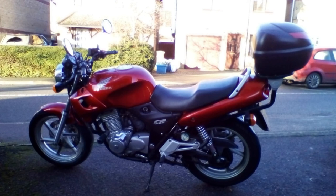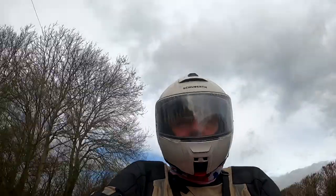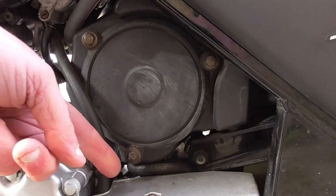There are a few things that can go slightly wrong if you're looking at buying one of these. Try taking this bottom bolt out — or see if you can — because they are prone to seizing up. The air filter lives behind this. If it does seize up, the solution is to grind the head off the bolt; the other two should still be fine. If you can't get any of them out, unless you're really desperate and fancy buying a second housing, walk away — because you won't be able to change the air filter.